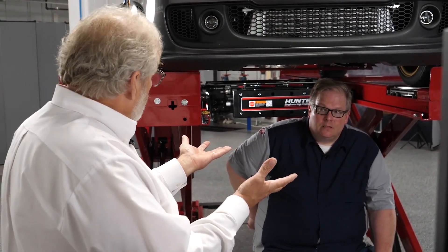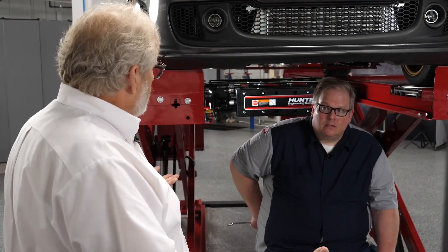On step three of that process, we can actually jack the vehicle up — that'll release the load on it. We can adjust the steering wheel position, bring it back down onto the rack, and make sure it's still okay before we tighten it down. It's also very important that you jounce these vehicles. That can be a difficult vehicle to get a straight steering wheel, but if you follow those steps you'll have good success.